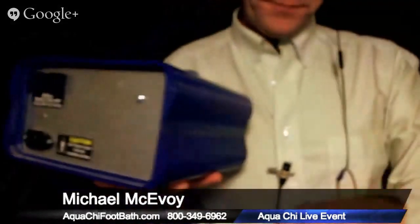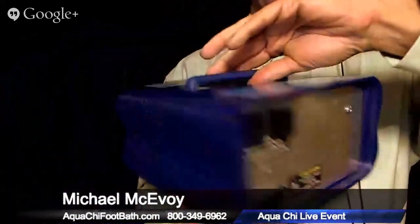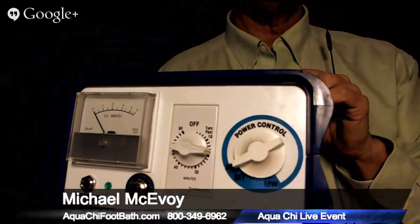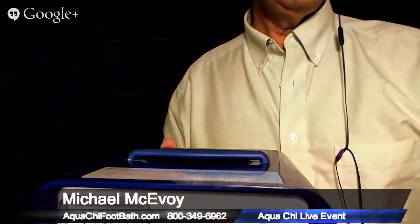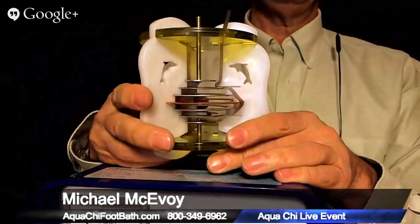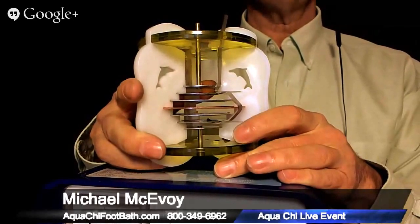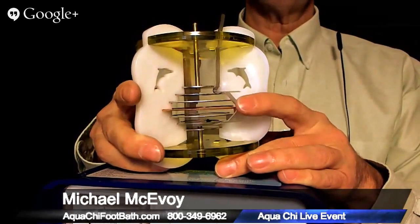Hey, I'm going to bring back our trusty AquaChi Power Pack. And I'm going to answer the question, what is the most common reason that you blow a fuse on the AquaChi? There's only two things that can cause you to blow a fuse, and I'm going to talk about those right now. They both have to do with the module, okay? The first and most common reason is that people, when they put the module in the water, add too much salt to the water, and that causes the needle on the front of the machine to hop up over to the right, over to 5, and it will blow a fuse in almost all cases if you have too much salt in the water.